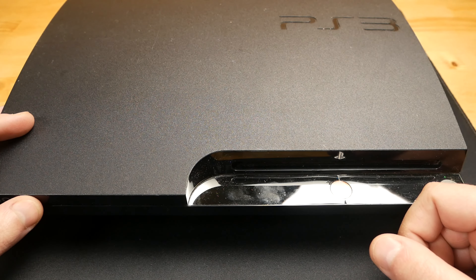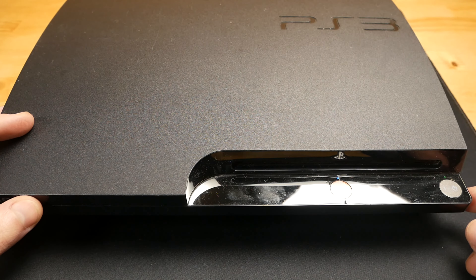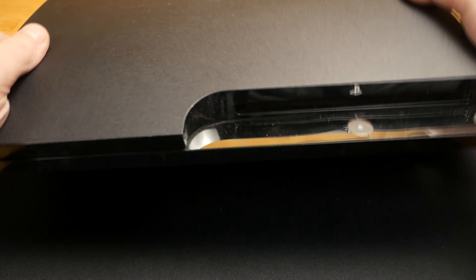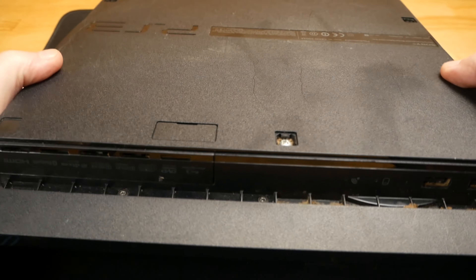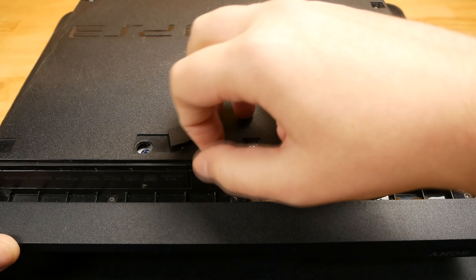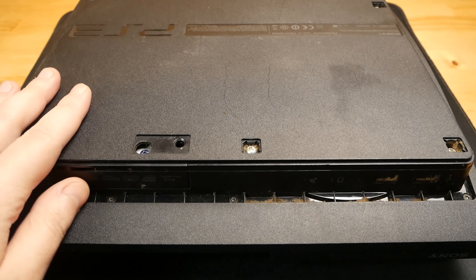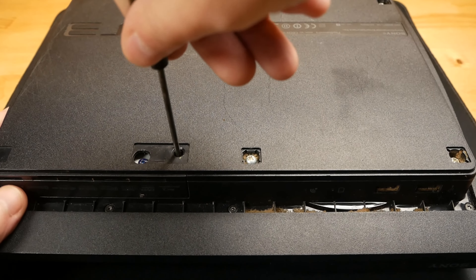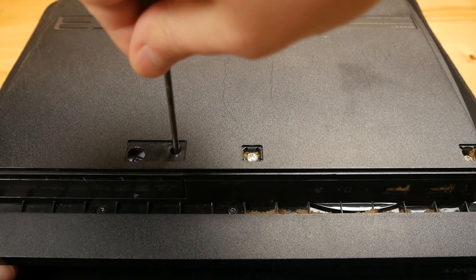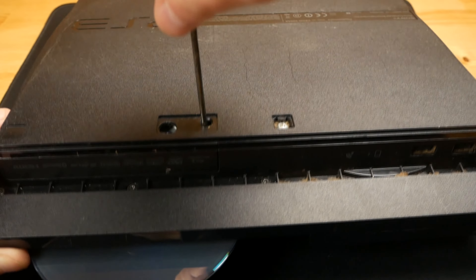So there's one little trick I can try — this is the easiest way to force the disc out. I open the cover where the hard disk drive screw is and I pull it out. I ignored the screw, but in the other hole I use a flat screwdriver and I rotate it counterclockwise. Now the disc is forced out.